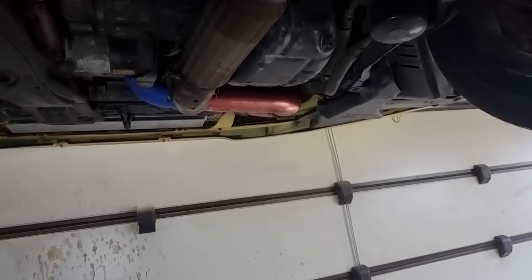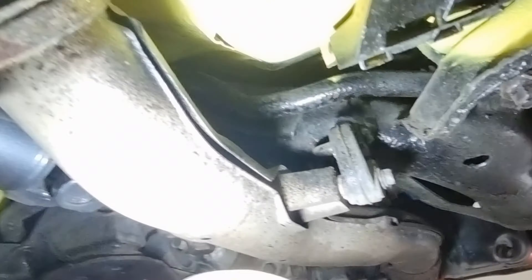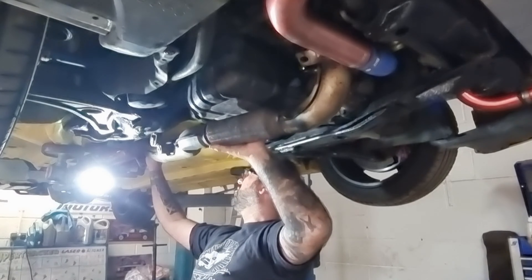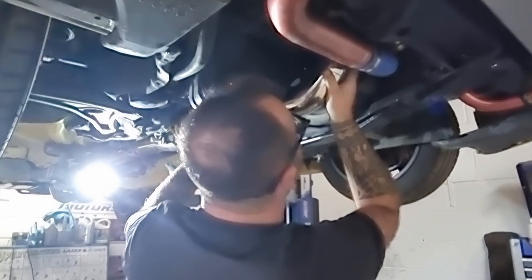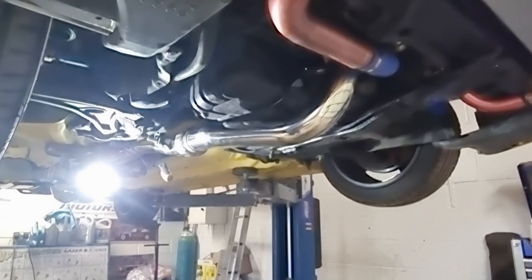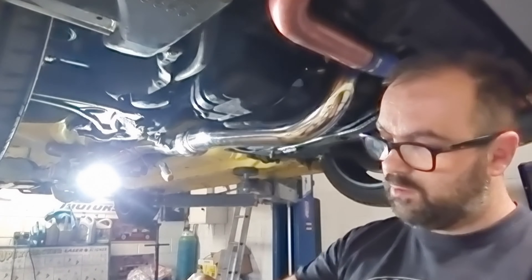Metallic prop — what a whopper. No play on the prop, which is good. So just this one bolt here to come off, a couple of bolts here — it's already off at the front, so let's get that ripped off now. Note: the bolts that come with the downpipe are definitely wrong, they don't fit. You have to use your originals with a slight smear of copper grease.